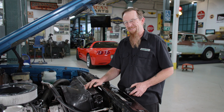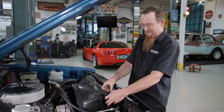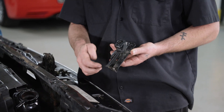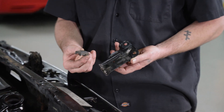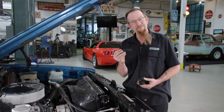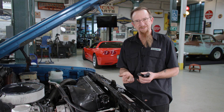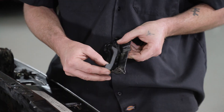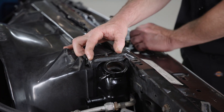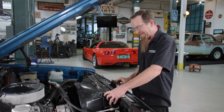The beauty of GM products is a lot of them, if not most of them in this time frame, all use the same system for clamping in the radiator. It's just a top — sometimes it's a full cover — but the important part is there's a rubber saddle that goes in here. Ours was completely broken; I didn't realize this and didn't buy one ahead of time. But the beauty of GM is I pulled one out of our stash, which I believe was for a Corvette — quick modification just because it was longer, but they're pretty much all the same. You really don't want to overlook these rubbers because they hold the entire radiator in place. If the rubber is not good, your radiator can rattle around, wear spots, and next thing you know you have a hole.